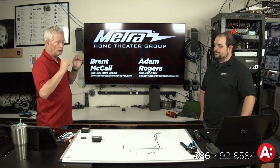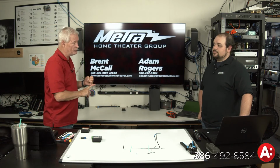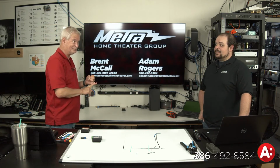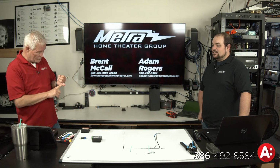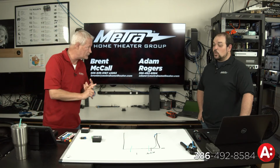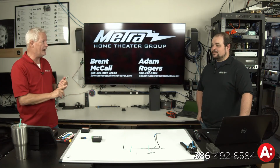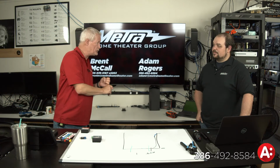Now, when you're looking at an AVR, the questions you have to ask yourself: has there been a firmware update? Do you have automatic firmware update turned on? Now, it may not just be the AVR. There could have been a firmware update on your Xbox or your PlayStation or your cable box. Or does it need a firmware update? Yep, because that happens also. So, also check the inputs on the AVR.